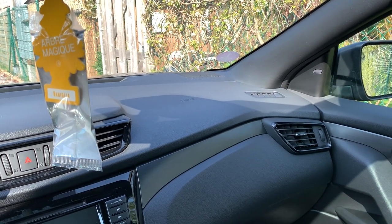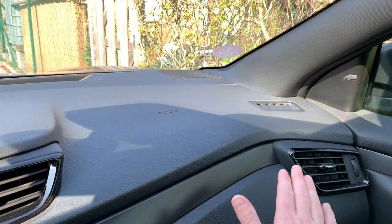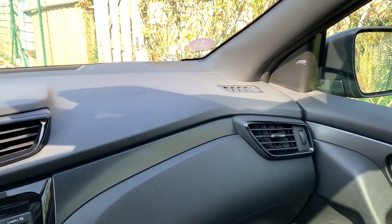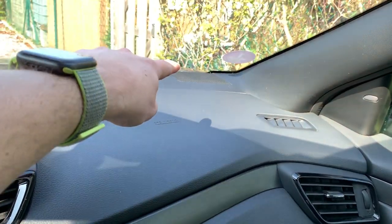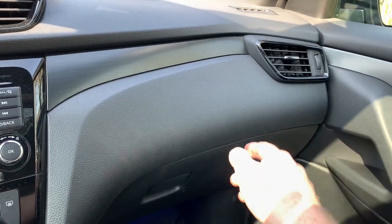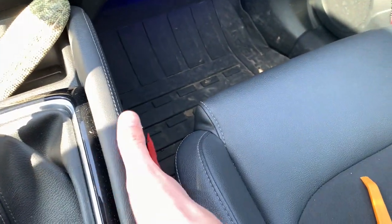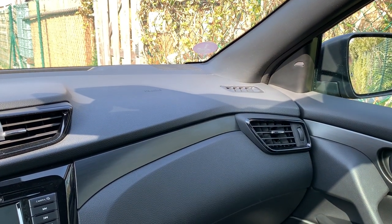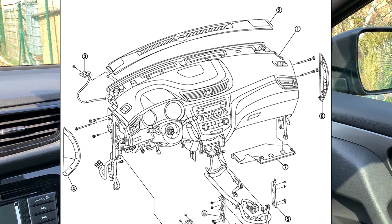So to troubleshoot a noise it is always better to have two people in the car — one driving, another one testing and trying around. I noticed while driving, when I push here or on the top of that, the noise disappears. So I'm first going to check that option. Otherwise it could also be the part on top hitting something, or a part in the cover of the glove box that could be jiggling around. I've also heard of people who had just the side panel moving a little bit, so you really should troubleshoot for yourself.